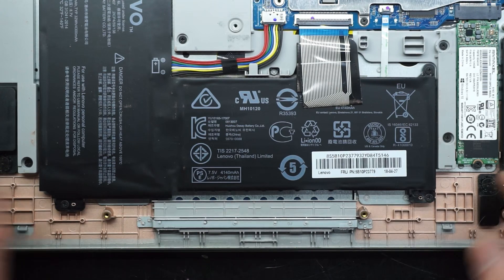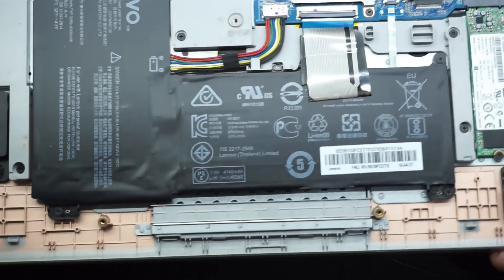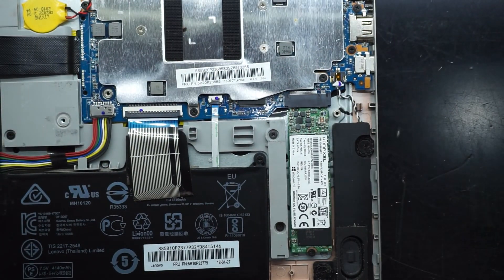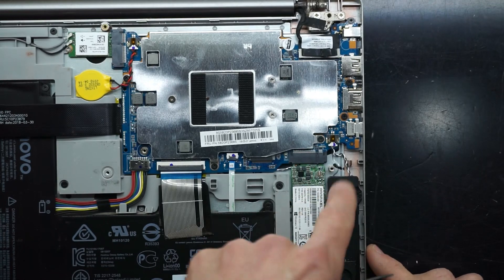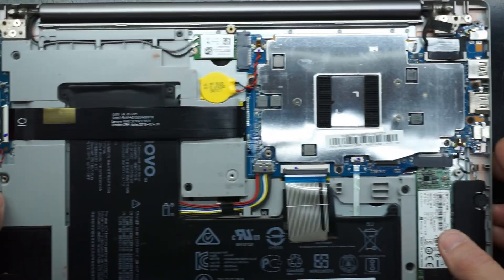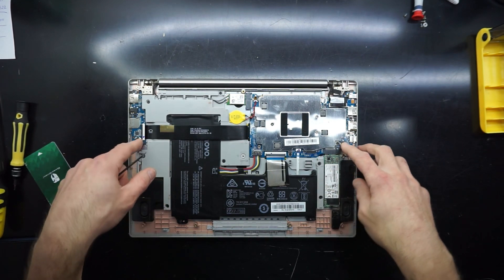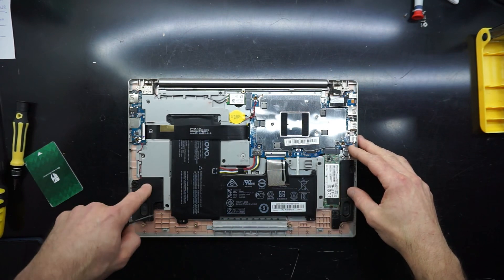We've got nothing really going along the front here. Looks like a bit of a brace for the trackpad, so when you click, that'll be where it's pushing onto. Moving on to the right-hand side, we don't see many points of upgradeability. There's the stereo speaker over here — I find it slightly odd that the connectors are on the left and the right of the main board, on a daughter board and the main board. Typically it goes to one point and then daisy chains over to the other speaker.